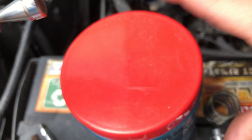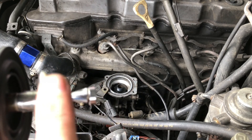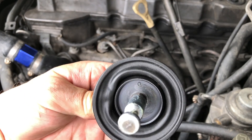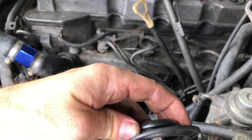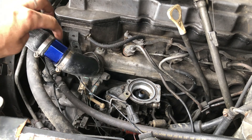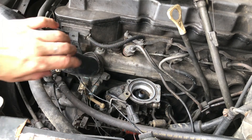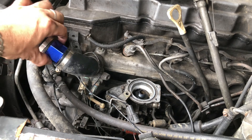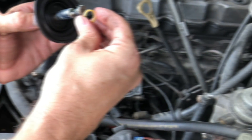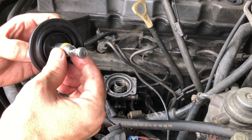Now I'm going to put a little bit of grease on here, put my fun police spacer back on, and put the diaphragm back together. Let's put a thin layer on here — this is also going to help hold that shaved spacer in place so it's not going to be as likely to fall off. Now I'm going to find my zero, which is there. I'm also going to put some grease where the fuel pin will be sliding. For anybody who's wondering, this is the housing for the water temperature sensor — the sensor is over here. I've put it out of the way so if I'm reaching in here I'm not going to cut myself on that. Anyway, there it is — it's just a cheap online anodized aluminum piece. I'm really happy with it, works really well. I think I've shaved slightly more than they say to shave, but some guys just chuck it right in the garbage anyway, so I think that'll be alright.